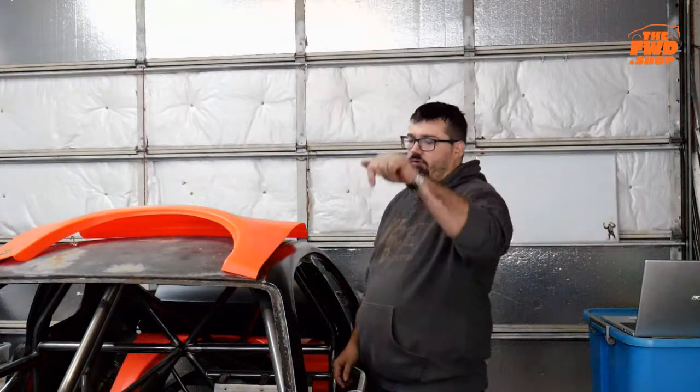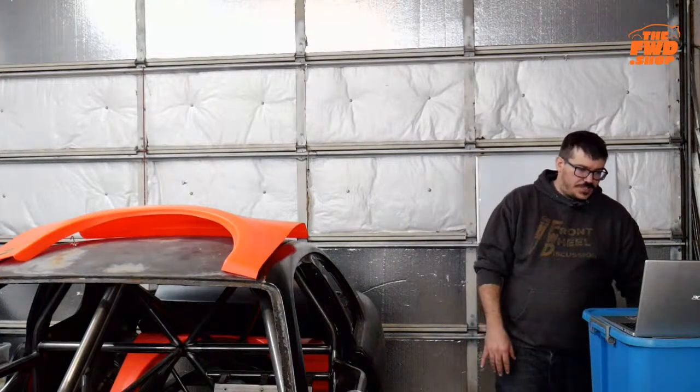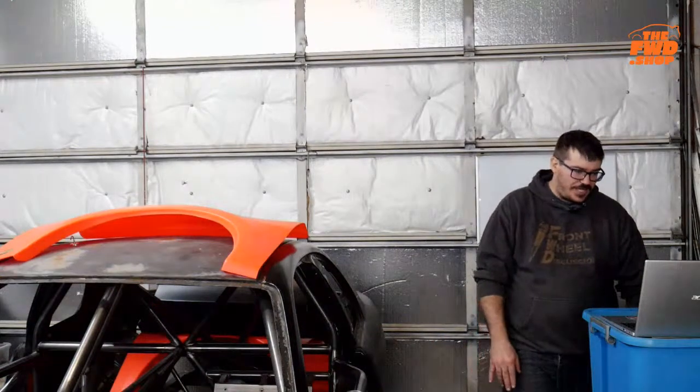Like, I can tell you right now, if I was going to twist one of these cars, I wouldn't do the rear. I would take the left front strut tower and I would move it as far to the earth as possible that I could get away with and not move any of the mounts on the suspension. Like, if I could keep the K-member mounts where they are, but I could take the strut tower and move it down a half inch or an inch, I absolutely would, because I want that bent like that. That will never change. So hitting the wall just right makes them handle better. It can. It absolutely can.